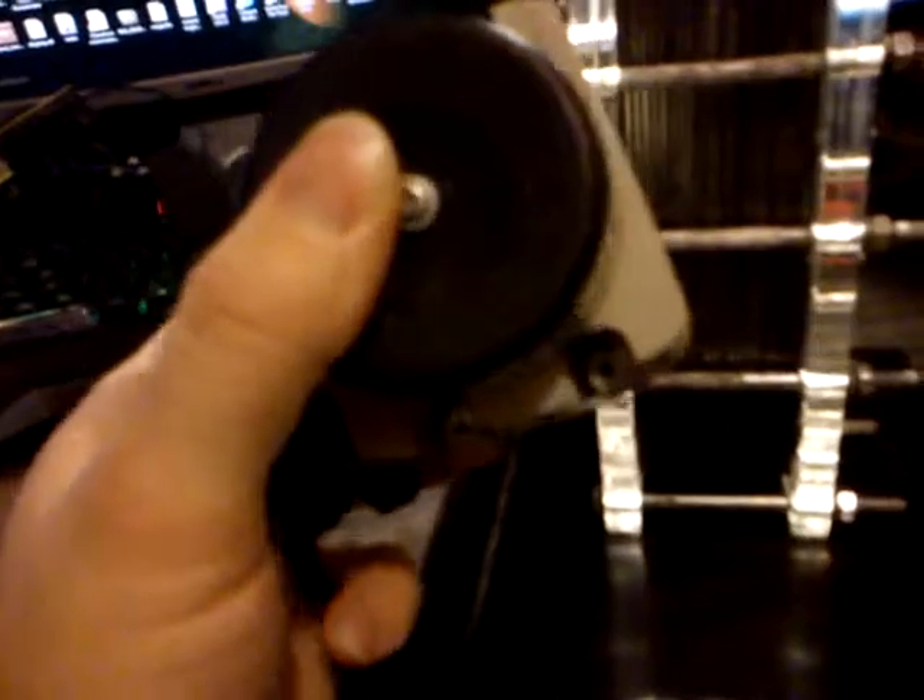I've got a bit of a thing here we're going to have a look at in a minute. Apparently it's a solid magnet air pump. Someone's used it at some point to pump water through it and suck flames through — as you can see on the bottom it's all deformed. The magnet got jammed in it somehow. It's had its cable cut off, but I think I can get inside it and put a new cable on. It's used for aerating ponds. Maybe if I can free the magnet up it may work again. Last time we put it on power it just didn't do anything — didn't heat up or anything. So either the coils burnt out, or the solid magnet inside — the slug — is just locked up. We'll see.